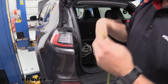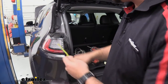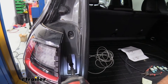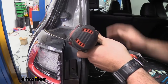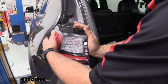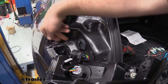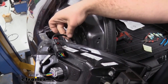Starting on the driver's side, we need to remove the taillight to feed the wires up. Using a T30, there are just two fasteners. Pulling the taillight out can be a little tricky — a quick wobble allows it to pop out. If it hangs up on the clips, use a plastic trim panel tool to pry it. This reveals the plug, which we need to separate to tie into. To remove it, pull out the red locking clip, push down, and it should separate.